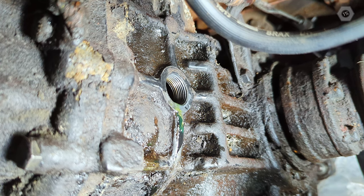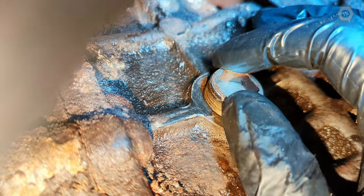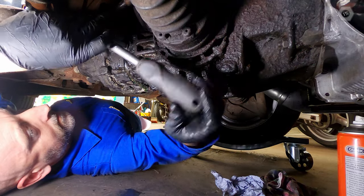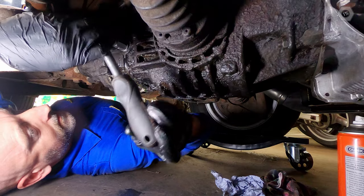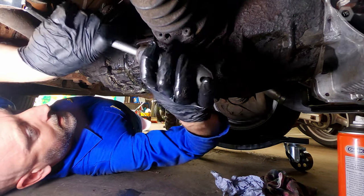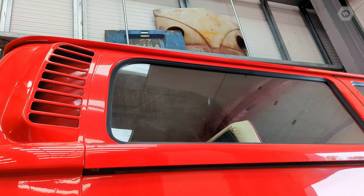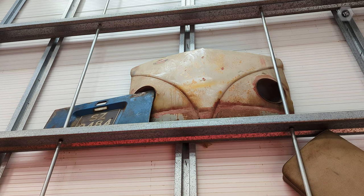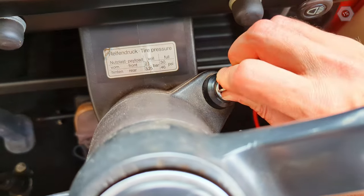That's the correct amount of oil — when there's just a gentle trickle coming back out of the hole towards us. I will, in future, remove the engine and gearbox as a complete unit to replace all gearbox oil seals. But the real reason for this top-up was to see how much oil was actually left in the gearbox. This is a really low mileage, factory-fresh bus, and I want to keep everything nice and healthy. I only pumped in 150ml of oil, so now I know it's not losing all that much over time, and so it's good for the summer.